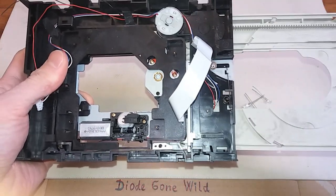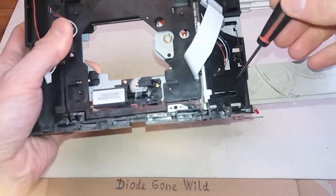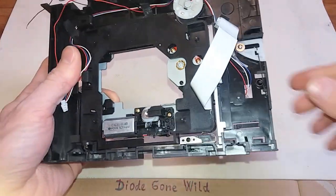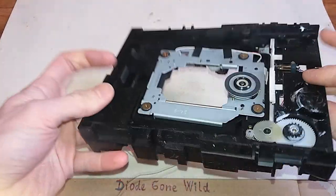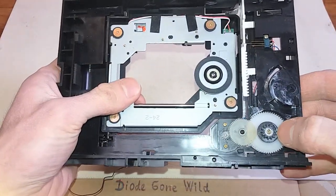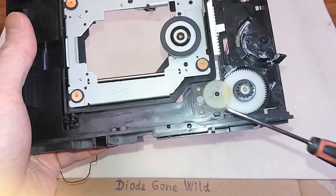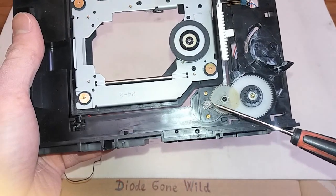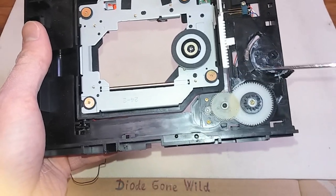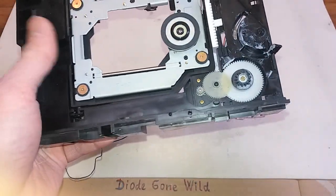To be able to remove the tray, you have to remove this piece of plastic — lift it up and remove it. And here you can see the motor with gears. Because the motor requires quite a high RPM to generate power, you want to keep the original gears. Just cut the plastic around and keep the motor with its gears.